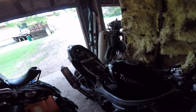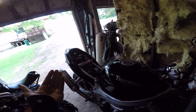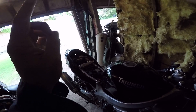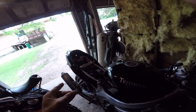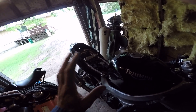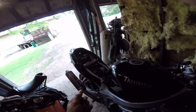It was hesitating, and I don't want that in a curve — that's going to get me killed. Once you get up to enough speed the bike smoothens out. A lot of people say it's only at a certain RPM, but if you know what to listen for it's at every RPM. At 3000 RPM it's not magnified yet, just a little hesitation pulse — still a pretty smooth bike — but it's starting, so it could be a valve issue.